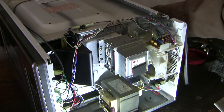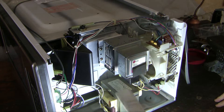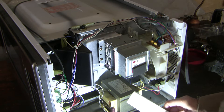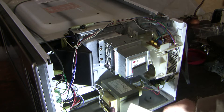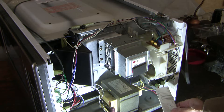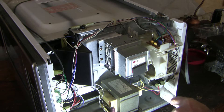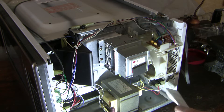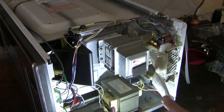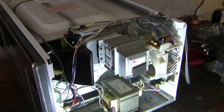I'm going to show you the normal structures here. This is the magnetron — it produces the microwaves. And this is the transformer. The magnetron requires really high voltage, so they step up the voltage with this transformer. It's really heavy. Then you've got the high voltage capacitor, and you've got to be careful of this because it can give you a nasty shock, especially if you haven't turned it off very long ago. This thing right here is a high voltage diode — it occasionally goes bad. This is the fan, and there's a second turntable motor underneath.